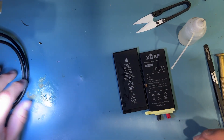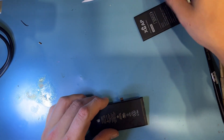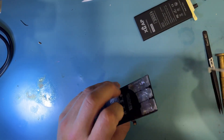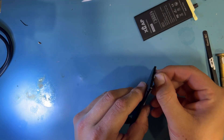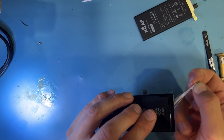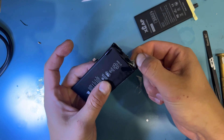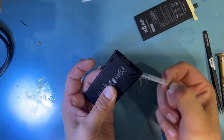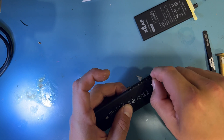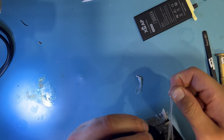Okay guys, doing a full speed video of a core replacement. I want to show you that once you get this process down it is very worthwhile to learn, and it really doesn't take that much longer to transfer the BMS over to the new core. First things first, we're going to unpack the BCM — BMS, whatever you want to call it.